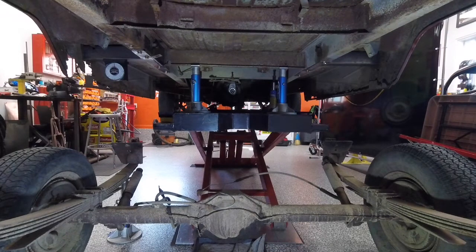I'm just getting ready to put the rear end back in as a test fit, and you can see clearly there beside the blue jack stands the pieces I've bolted to the frame and the box section. Over on the left-hand side I have the angle finder on there. I've checked the truck frame, the front axle, and those two spring perches — the three-by-three box section. Everything's level, everything's dead on. I'm real happy with the squareness of the whole thing.